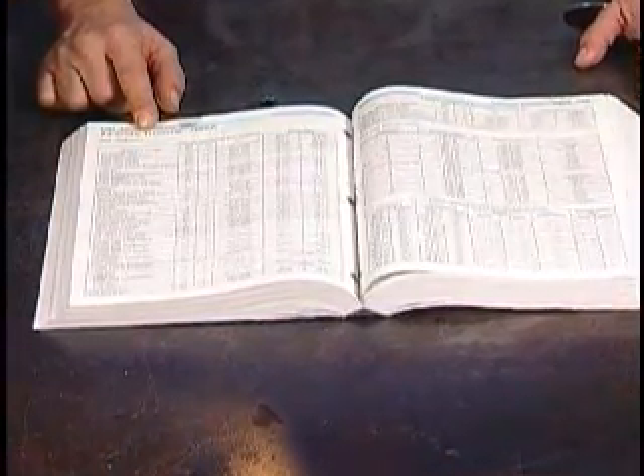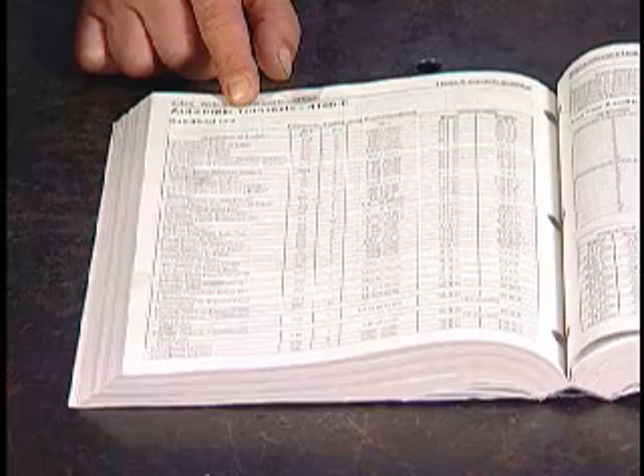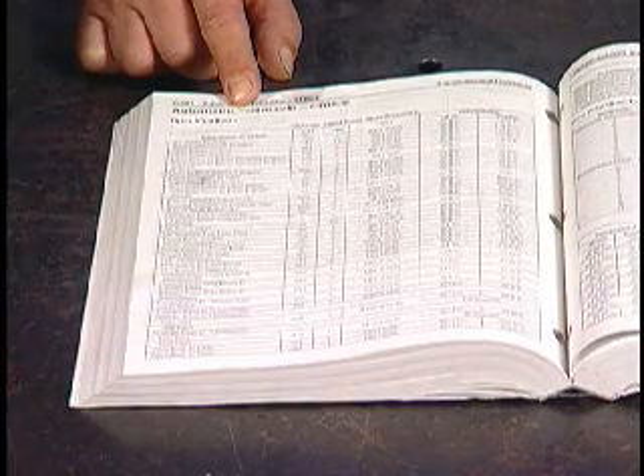Their thinking is that if you acquire the correct overhaul kit for your vehicle, then no adjustments are required. As a general rule, clutches need 8 to 12 thousandths of an inch clearance per friction plate, unless otherwise specified in a factory service manual.